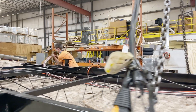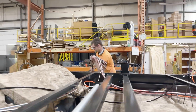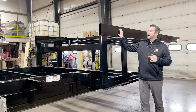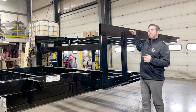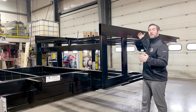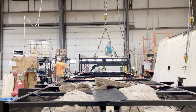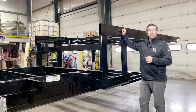It is the foundation of what's going to make DRV different. The other great aspect of our frame is going to be our upper deck. Nobody else in the industry is going to build an all-steel upper deck like DRV does. We have an 8-inch box tube that's going to run from the moment you get up to your upper deck all the way forward. Everyone else in the industry is going to stop and switch from steel onto aluminum. As you know, aluminum and steel can't be welded together, so there's a weakness in the frame — not with DRV. We're going to have the heaviest frame and the heaviest upper deck in the industry.